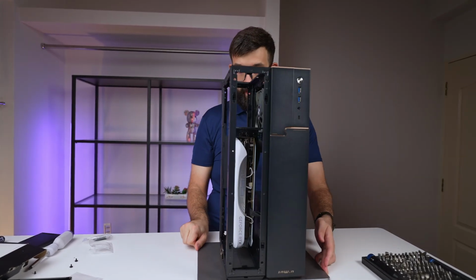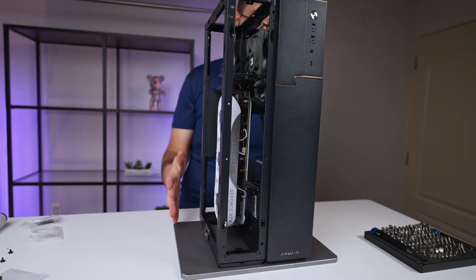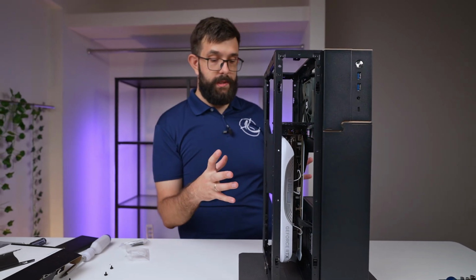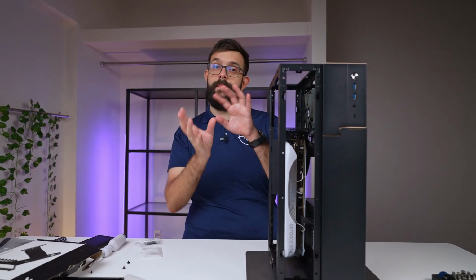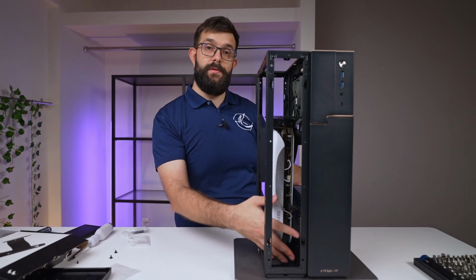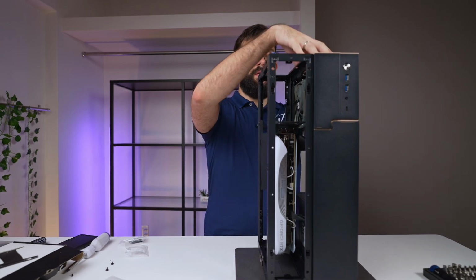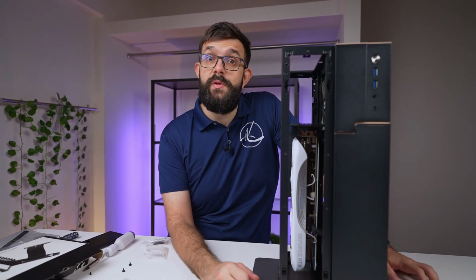There is clearly still a gap between the graphics card and the power supply, so the air can go around this area. And you can improve airflow in here, generally by reshuffling things how they are right now. I think changing the power supply's orientation, just flipping it 180 degrees, so the air that comes through from this end goes through the card, gets sucked in by the power supply, and exhausted from the back. At the same time, the air that comes in through here gets exhausted through the back and kind of outwards, which is very convenient. We're now going to close this up, test thermals, and move on to the cooler upgrade.